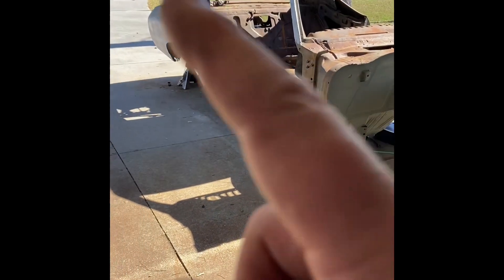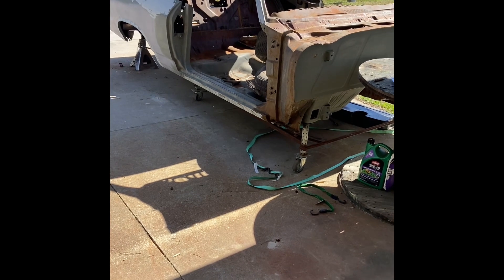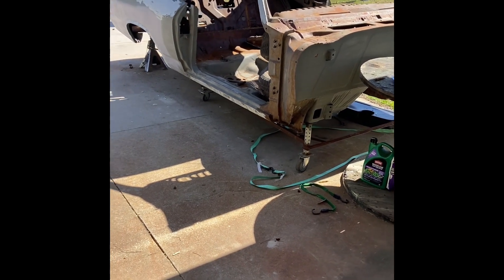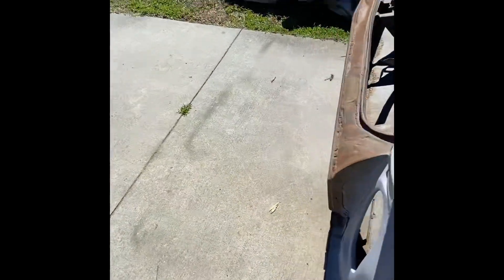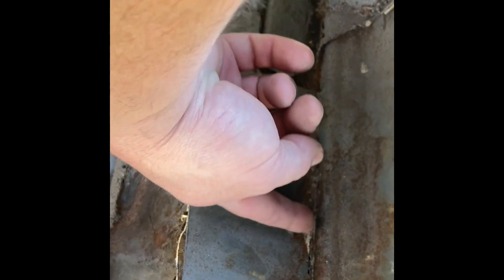But anyway guys, that's what I've got going on right now. So when I go to put that trunk in I might even shoot a little video of me cutting out the rest of it. It's been a real pain in the ass — I mean like on a different level pain in the ass. It's one thing to cut out old rot, it's another thing to cut out somebody else's really crappy sheet metal work and their bubblegum welds. Sawzall blades don't really do well through bubblegum. I can show you a perfect example right up here. Plus I'm cutting through two layers of 18-gauge metal. These bubblegum welds right here — I've got to come in here with that Sawzall and cut through that stuff. I've tried to do it with a whiz wheel and I can get some of it that way, but this thing is absolutely atrocious in every way. You can see where I've cut there and there's a factory floor pan on the backside of it — see, there's a factory floor pan and then they just put a piece of old galvanized sheet metal over top of it and beat it in. So I've got to cut all of this out with a Sawzall and then trim to try to make these new panels fit. It's been a freaking complete mess, guys.